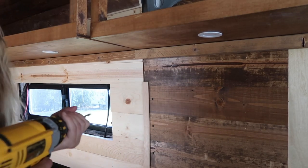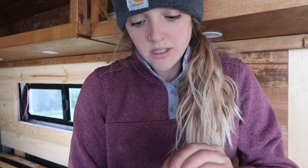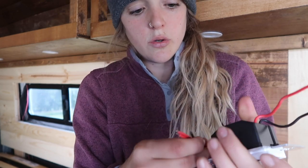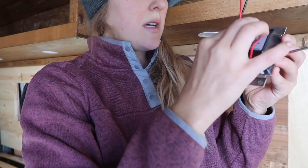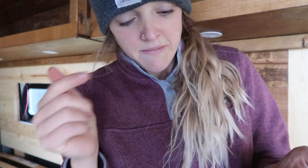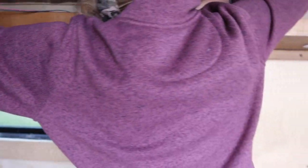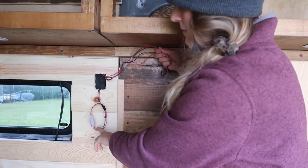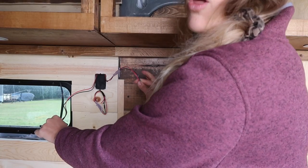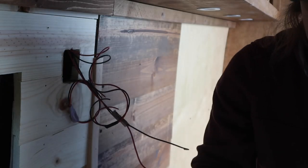I think I've decided to put my switch here. This is the switch I ended up getting — I'll link this below. It's super cool because it's a dual zone: one input and two outputs. My input is coming from the bottom, and then my two different outputs — one side goes over my kitchen and one side goes over my bed — so with a single switch I can turn on and off my kitchen and bed cabinet lights independently. This is going to be the switch input right here, and it splits off — one will control all of my kitchen puck lights, one will control all of my bedroom puck lights. This is all 14 gauge wire and I'm going to use female disconnects for 16 to 14 gauge wire.